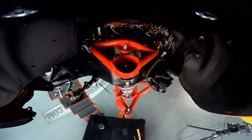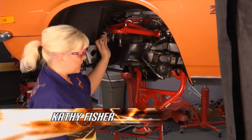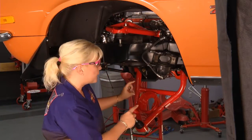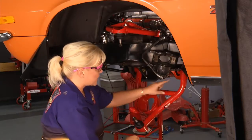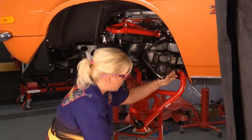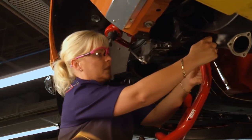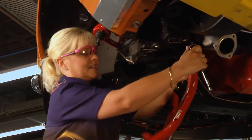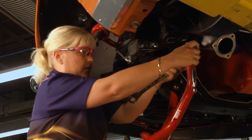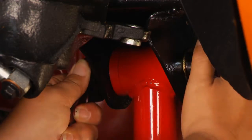Welcome back to Performance TV. I've got both bolts tightened for our upper A-arm and we have our bottom one partially installed. The first thing we had to remember before we slid this in was to grease it up a little bit, lube it up, so it would slide in and work better for us. One bolt started here — get our other one going. As soon as I get this tight, all we have to do is push this up and then we can start prepping for a shock.